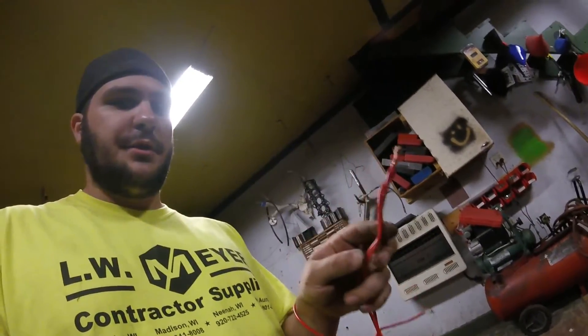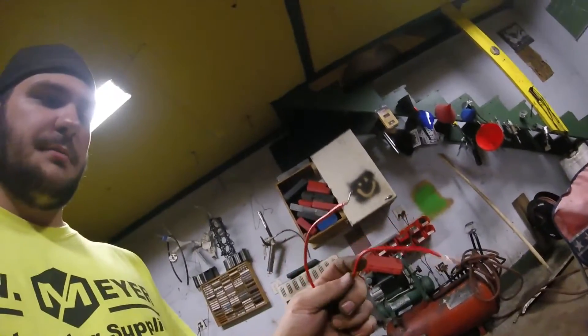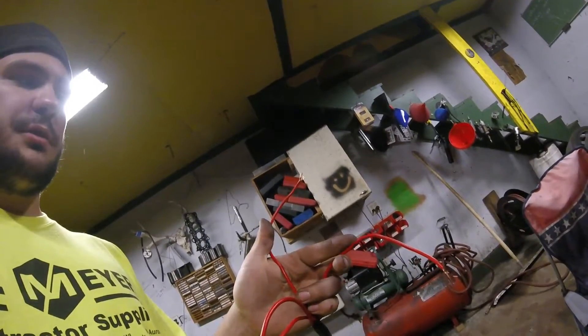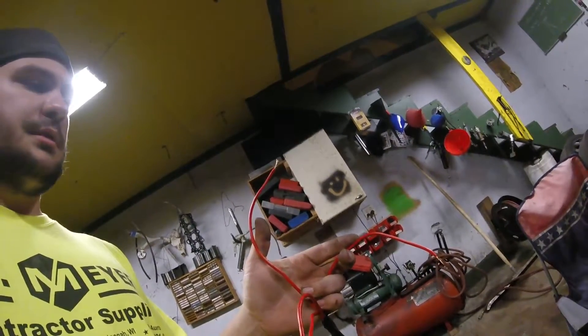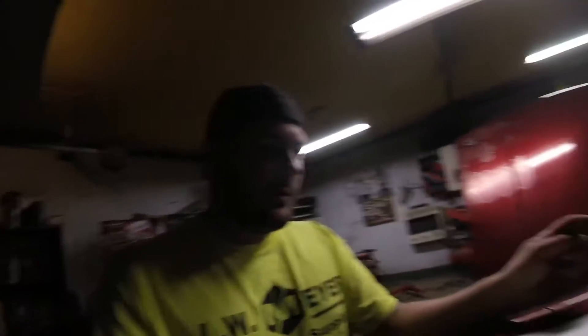So what I'm doing is using a relay to control a ground circuit. To turn the relay on, you need a power and a ground — these two wires I have tied together — and then this is going to be your input and output. One side will go to ground and one side will go to the micro squirt, or to the flex wire. That way I can use my brake switch 12-volt input to turn the relay on, and when my foot's off the brake, the 12-volt is not there, so the relay is off and the two-step won't work.